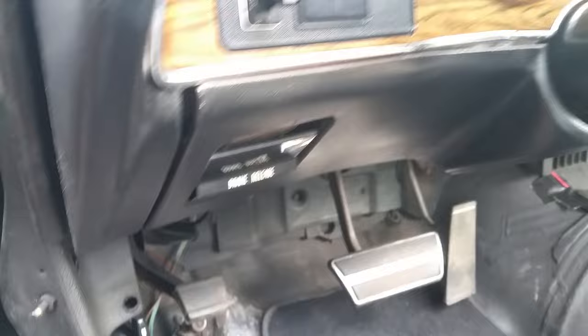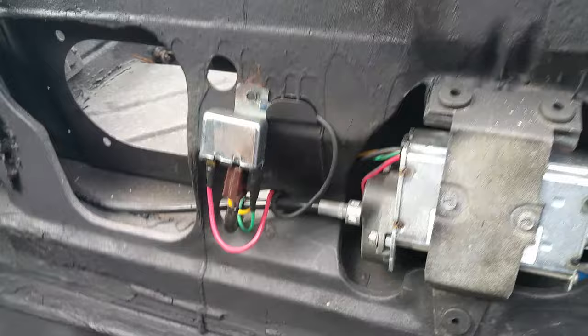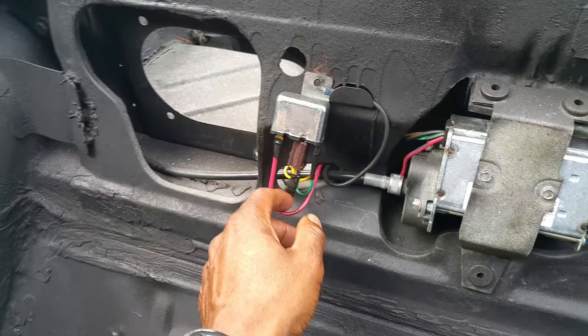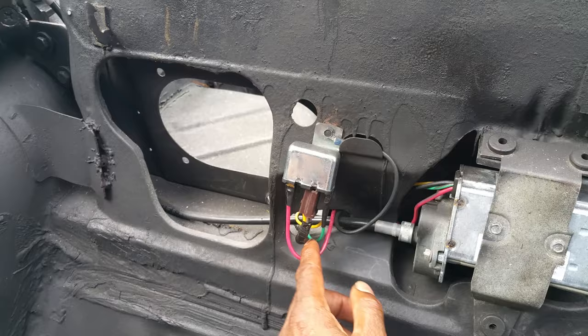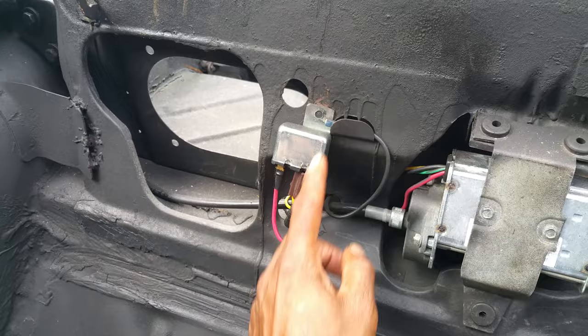If it still don't work after that, what you want to do is come back to the back of your car, take your back seat out, and check your relay. This is your relay. This is the main power wire coming from the switch and from the main power in the car. This is the power to your motor. These are the up and down wires to your motor. So when you hit the switch on the dash, it's coming through here and then it goes up in here and tells the motor — up and down — what to do.